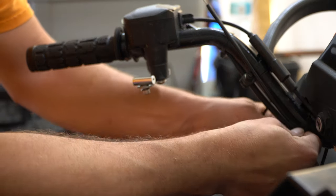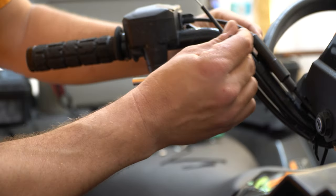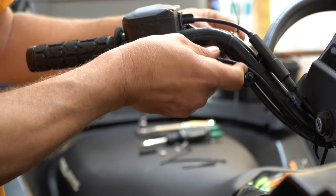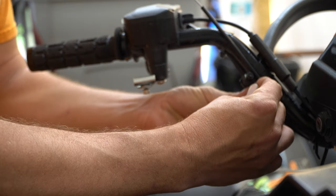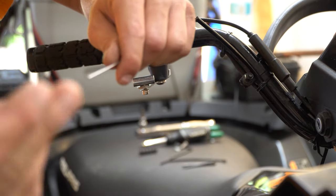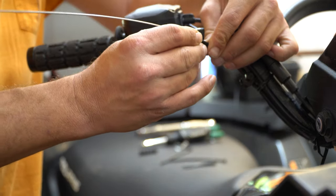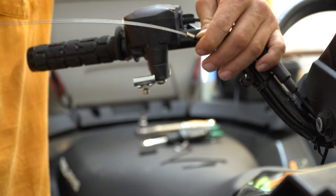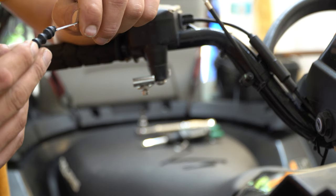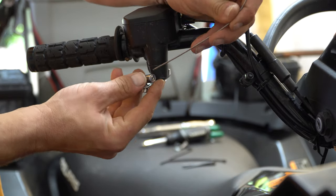We will comfortably route the wire so that it looks good and is functional, checking periodically to make sure we don't have too much pressure on it. There's nothing on the end of this wire and it is not binding at all. In this next step, we're going to use the provided cable ties and wrap up the wire, keeping it in the contour of the handlebar. Be sure not to tie up the factory cable and also not to strap it too high to where it can't function properly with the throttle assembly. Now it's time to take the other silver insert provided and slide it carefully — it's very soft so you don't want to bend it. Slide it all the way down on the cable. This protects the end, and next we're going to take this little accordion-looking thing and slide it down on top of the cable, then push the cable through it.